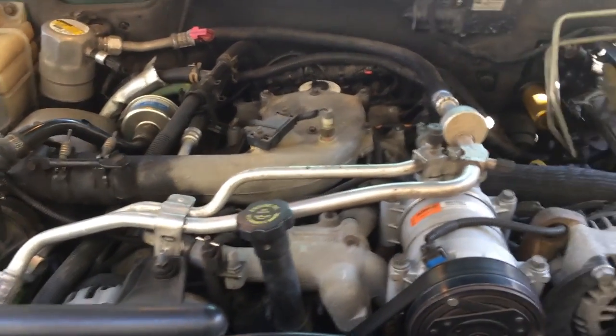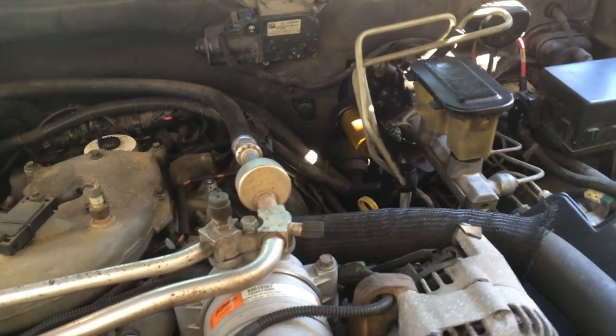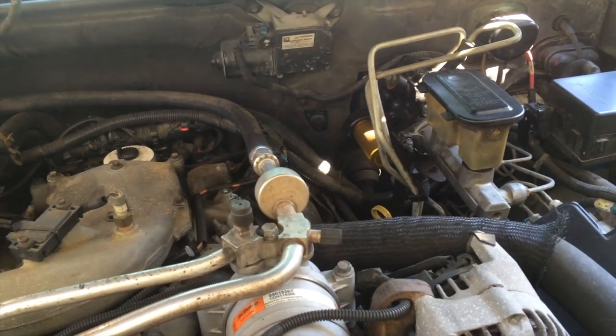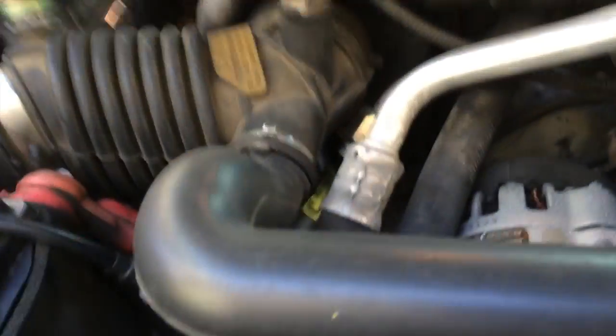This is very much like what you see on this vehicle — there's no vacuum power booster on the brake. This is actually hydraulically powered through the power steering pump, it's called a hydro boost. That's different on a diesel vehicle versus a gasoline vehicle because of that lack of vacuum. So let's start going through this, right at the source: the vacuum pump.